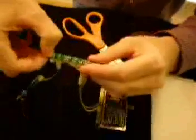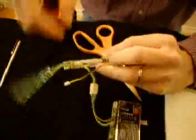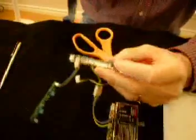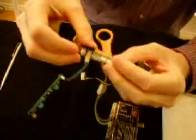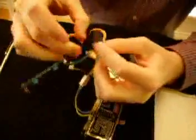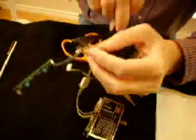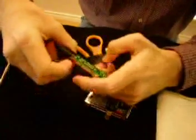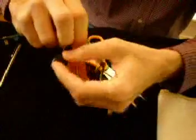And what you want to do is, see all these metal pieces — you've got these metal pins sticking out here, you've got these pins sticking out here. All of that you want to protect so it's not going to short to anything in the mixer. So you just go here, take the tape and just wrap it, and you just keep wrapping it. Make sure you get over all this stuff — this stuff you don't want to be exposed.